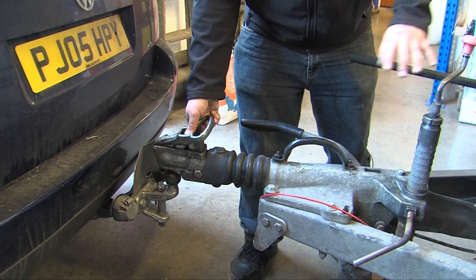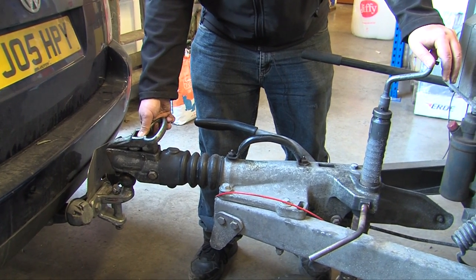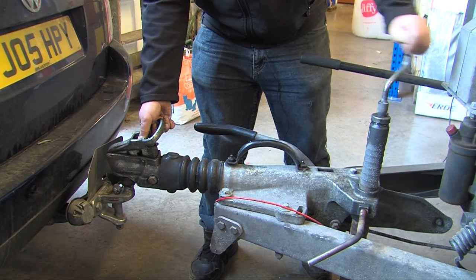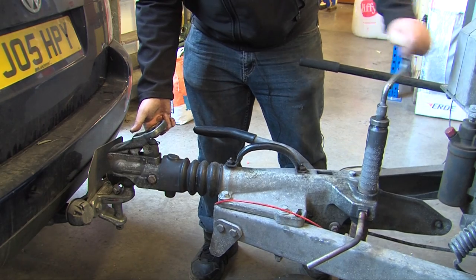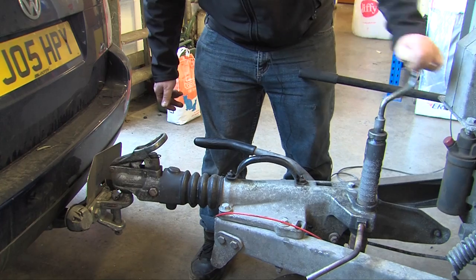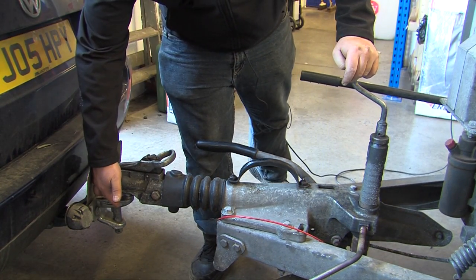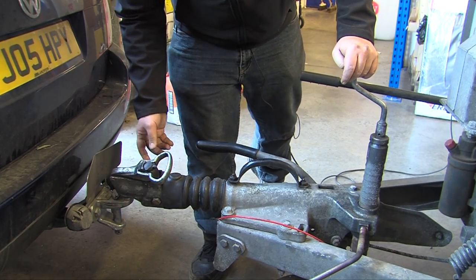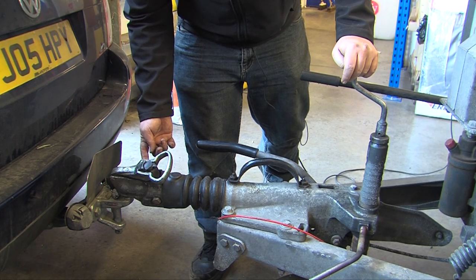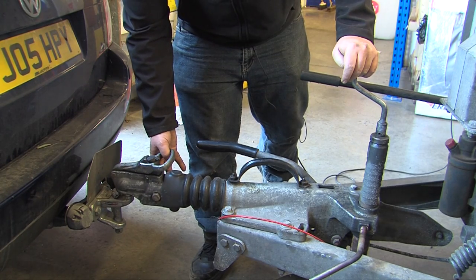This is on a jockey wheel, which most large trailers with brakes are, but some aren't. I'm using the jockey wheel with the coupling head open to lower it down onto the tow ball. This automatically locks and the ball has disappeared inside. There is a wear limit on the side of the coupling head that shows whether the coupling is worn.